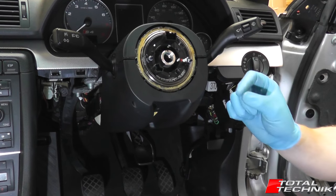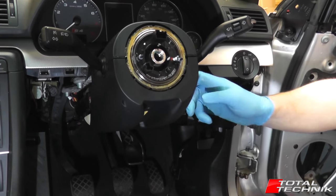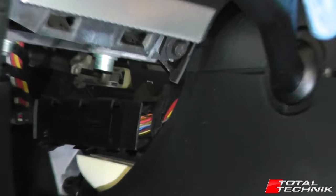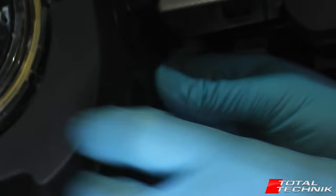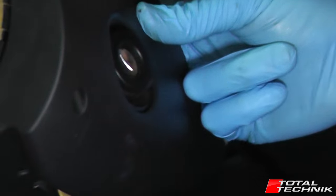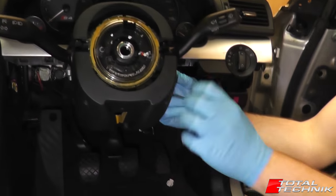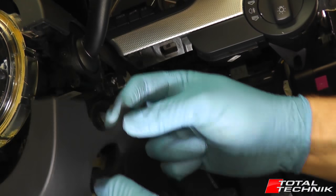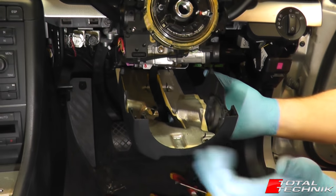One thing to note: there are little plastic clips that hold the top and bottom half together. They don't exist on the front, but they do exist towards the back. So the first thing to do is try and pop those apart a little bit — as you can see, there's a little plastic clip there that holds these together. Do the same on the opposite side. The next thing to concentrate on is this rubber section that sits around the key chamber here. Put your finger on the inside and try to take the rubber section with the cowl. So as you can see, the cowl is now completely loose and ready to come off.